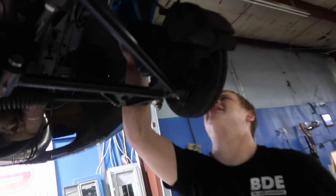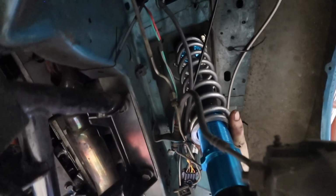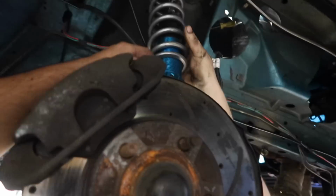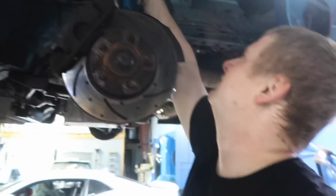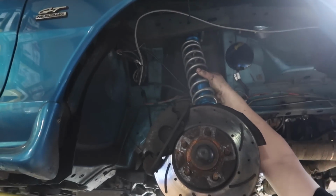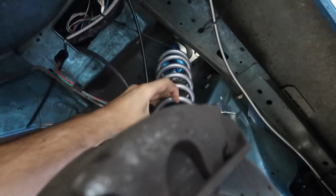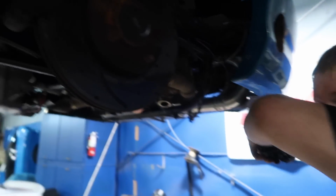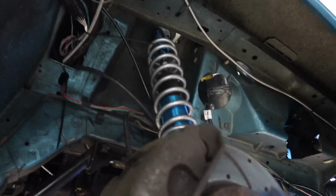And we have to turn these guys up to take up a little bit of the slack, you know? I feel like that won't raise it up anymore. Oh god, yeah. Just going four turns raises it up like half an inch. Really? You're talking about the spring coming off the... Well, the only saving grace is it doesn't touch anything until it gets to, like, there. The only saving grace is that top piece generally falls and it stays centered. Right. So, we're going to have travel limiters on it, 100%. That's just something that we need. We need travel limiters.